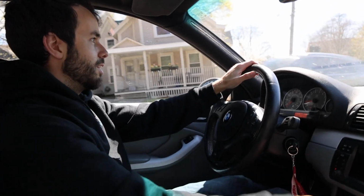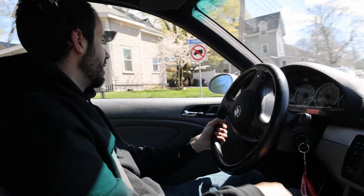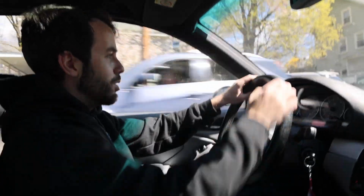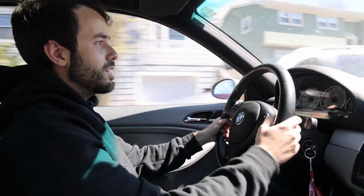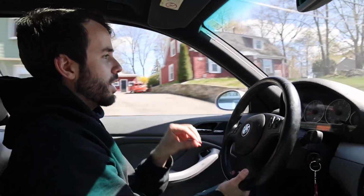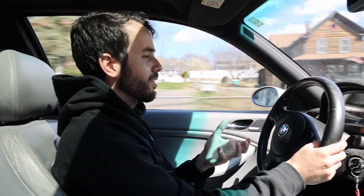All right, we're rolling. Got me? Yep. All right, Pound and I are on our first drive with the coilovers on. We're on our way to get an alignment, which I think will be in the next video. But we have every damper in the car set on 10, out of 24 settings for the damper, which I think is a little less than halfway stiff, would be my logic, right? Does that make sense to you?